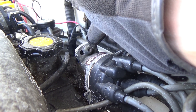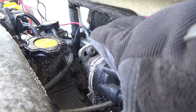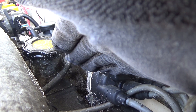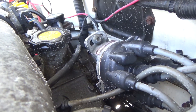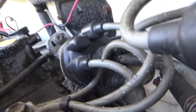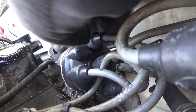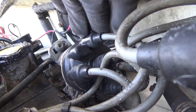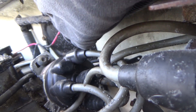On your distributor, you're going to have to walk it. See how the distributor is sitting even in the slot? When you slap this distributor in, this gear is going to walk. You're going to have to move your distributor away from one side, slap it in, and it should walk. If it walks the wrong way, pull it out and put it on the other side.